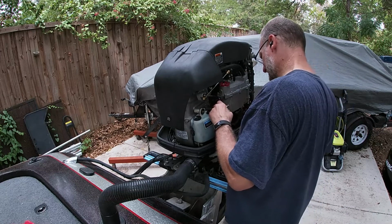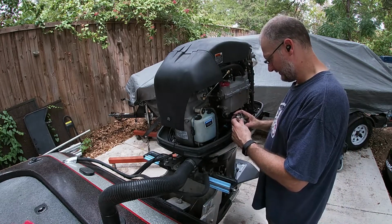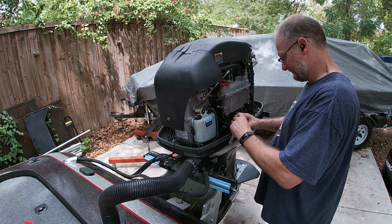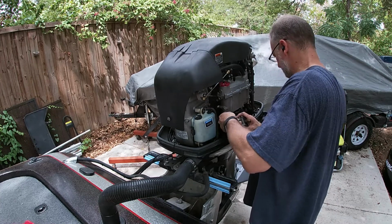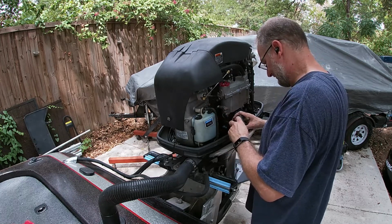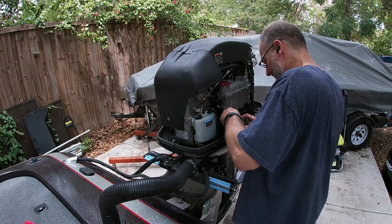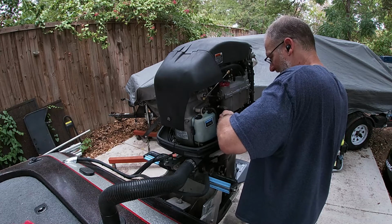Okay, so now there's the lift pump. I'm going to take the next two bolts out, paying attention again to how it's orientated. Let that be caught, and catch the stuff down there that you can't see. Same thing with this one, crack it. Careful when you take these bolts out, you don't want it popping apart on you, because it will.